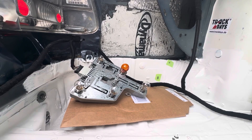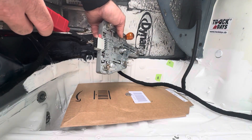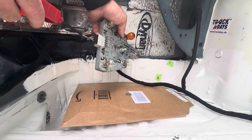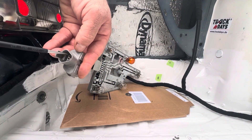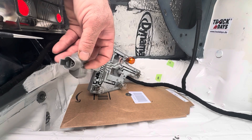The first job with this PDM install is to start from back to front, so I'm going to start with the rear lights. Here's the rear light cluster — a typical W202 rear bulb holder. It's got two side lights, indicator, rear fog, and reverse. I'll show you those now with my power probe. I'm going to wire the rear fog and both side lights into one input. I've got my brake light. The indicator will obviously be on a separate circuit. These two — the green/white wires — will go into one of these pins. I'm going to use one of these five-way Deutsch connectors.